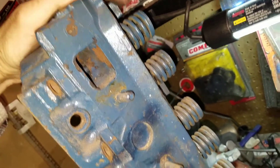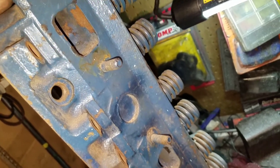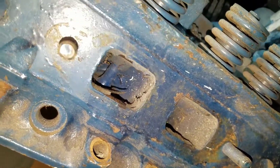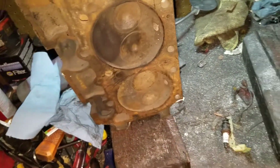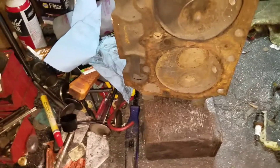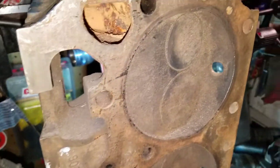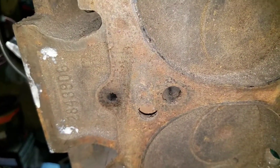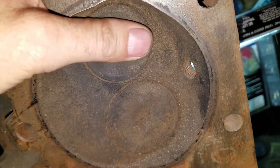Back in the day I fiddled with these a lot. I would get around 280 CFM by 550-ish lift with the stock valve. I thought that was pretty good - I still think it's pretty good, actually. A little 208 intake valve and 174 in the exhaust.